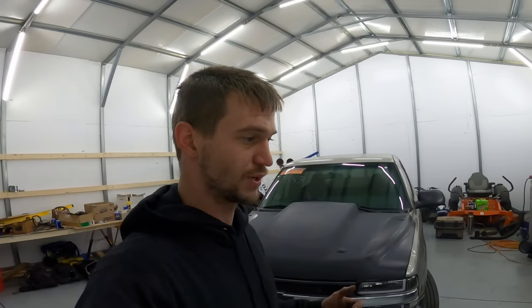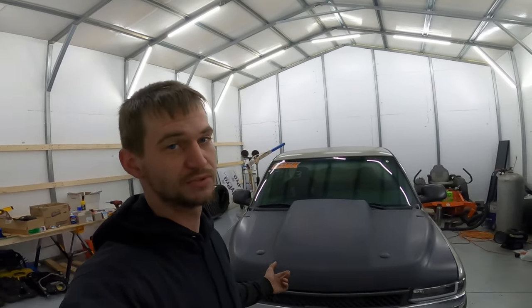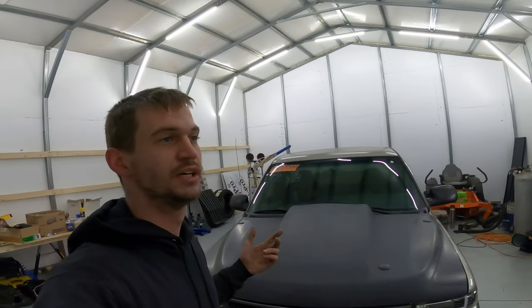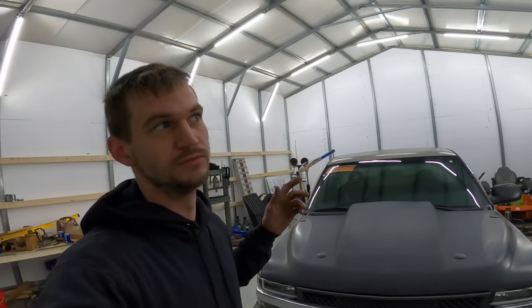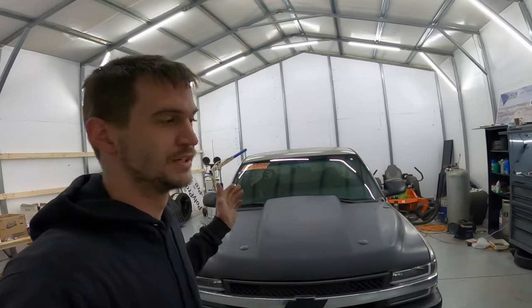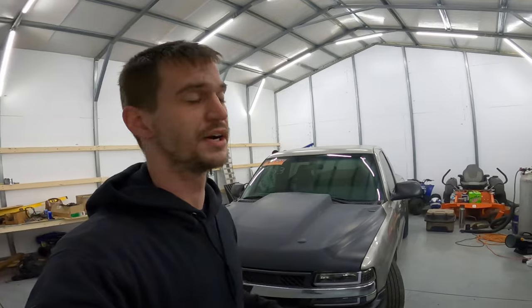Then after I got that squared away, I still had number 8 misfire. Well, number 8 coil and my intake air temp signal wire, those two pins was backwards in the harness. So I had to repin that to get number 8 coil working. And then the mass airflow intake air temp sensor, 4 out of the 5 wires was in the wrong spot on the connector. So I had to repin it in the connector that plugged up. Even though I ain't running a mass airflow, I still used the intake air temp sensor, but I went ahead and straightened them all out.